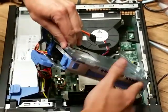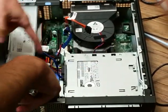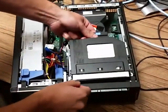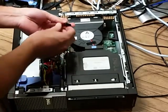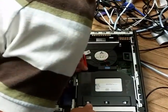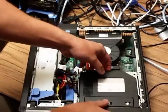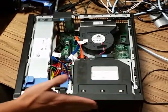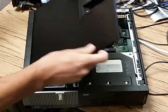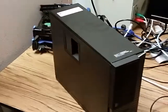Once that's done, put your hard drive back in — put in this end first. It'll slide onto the two little tabs there. Lock the hard drive back by pulling the blue lever back. Now put your CD-ROM back in — it just sits in here. Connect the cables: they have a little Tetris L shape, so just make sure it matches up. Same with the power cord. This just clips back into place — make sure it's flush with the front so that it's all the way in. The case: the bottom end goes in first, just line up the tabs and it will clip in. Then plug it in and log in to test that the memory is installed.